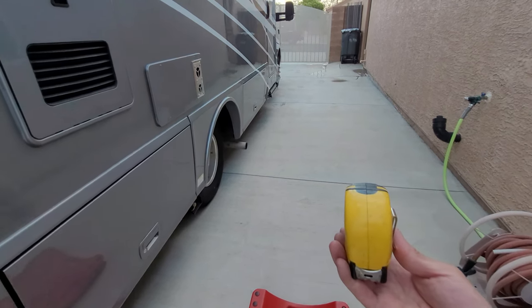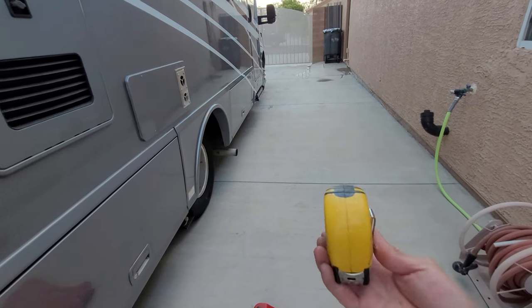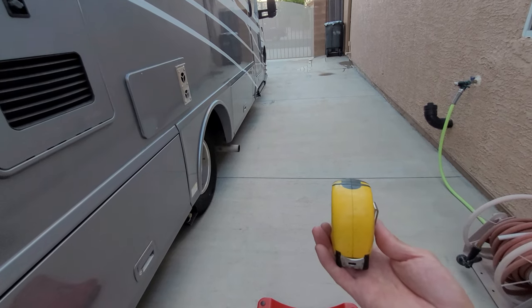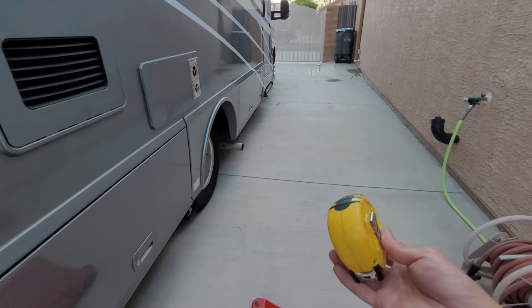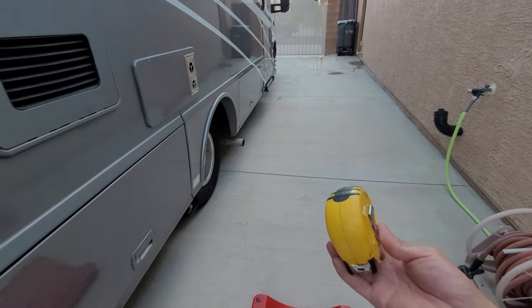And you're going to hear sometimes reports that a sway bar really helped on the highway. Well, the main purpose of the sway bar is really not on the highway. But I guess it does make sense, because if you can imagine, when a wind blows hard and it sways, that swaying also has a tendency to make it yaw at the same time.